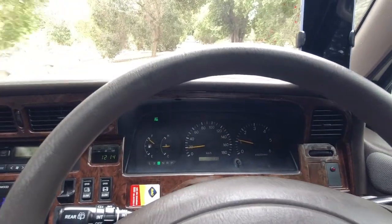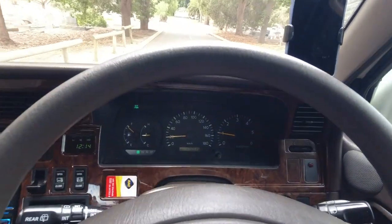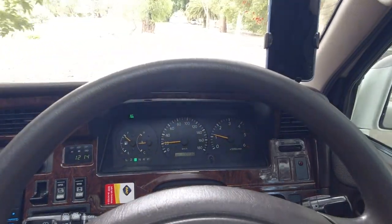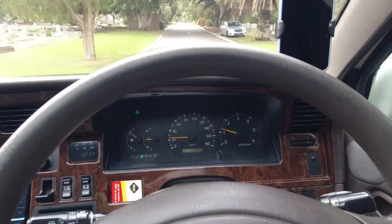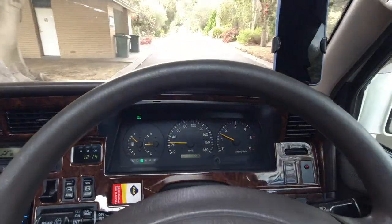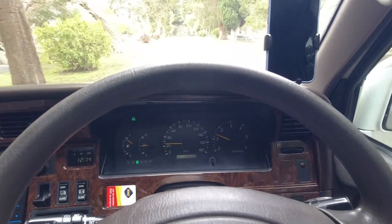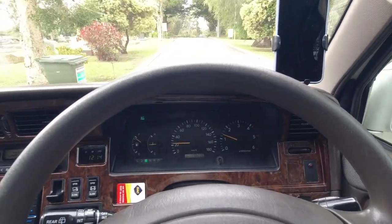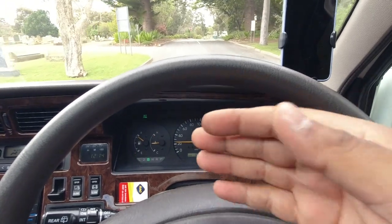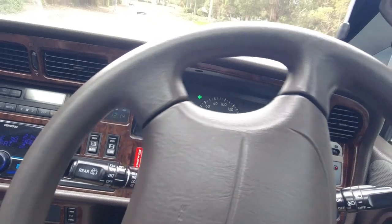Absolutely not. These cars are old. As they get older, these sort of urban legends come out more and more. Water temperature sensors sit inside water their entire lives. They're very prone to getting crust and crud built up on them. They're very sensitive bits of equipment, and they can start to read faulty, they can start to send bad data to gauges and the ECU and things like that. In my experience, when they get old and they start to become a bit wonky, they will always read 1/4 less than what the actual temperature is. So by the time your gauge gets to 3/4 of the way up on the temperature, you're actually blazing into the red and overheating.